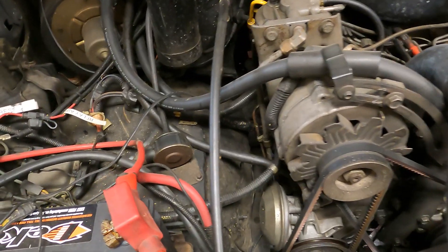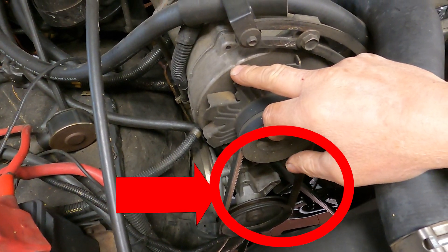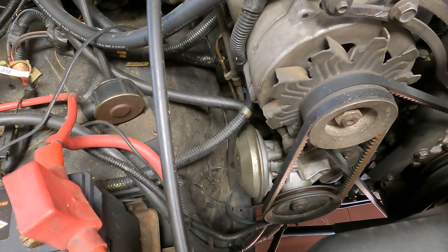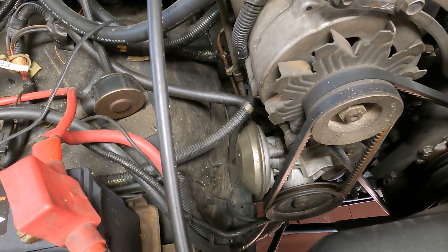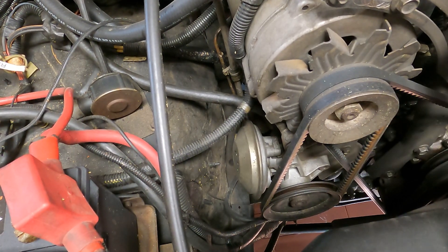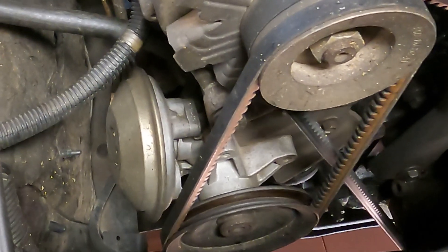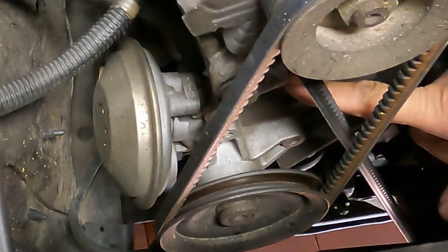Here's a quick picture of where to find it on the truck: the vacuum pump is located beneath the alternator — this is the alternator on the right side, and it's right here. It's not very hard to get to. There's one belt going to it. This is an older truck so there's no serpentine belt. What you do is take the thing out — I can see two 10mm bolts, one for mounting and one for adjusting the belt — and replace it.